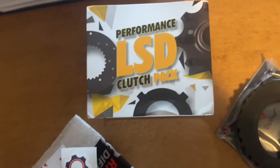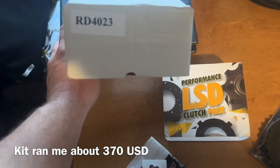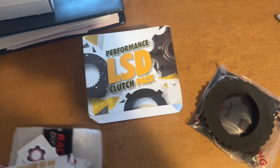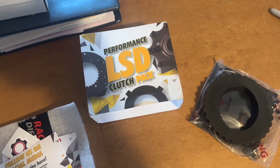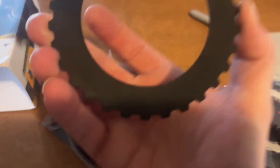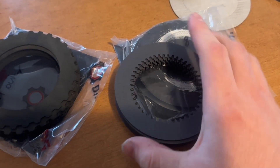Something worth mentioning is that this is the only kit that replaces just the friction discs and plates that go inside the clutch pack. There are no other kits that exist that can do this. The only other option you have is to buy a full clutch pack from Cadillac, which runs you $700-$800 or more. This is Racing Diffs Performance Clutch Pack kit for the Opel 4x4, kit number RD4023. I reached out to them and they said that even though this is meant for an Opel, it's the exact same thing as a Saab ELSD rear diff. The kit comes with brand new plates and also brand new friction discs.